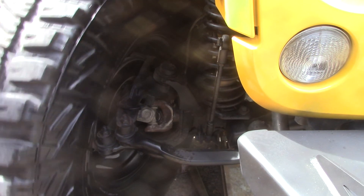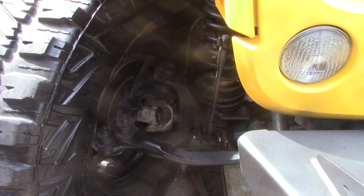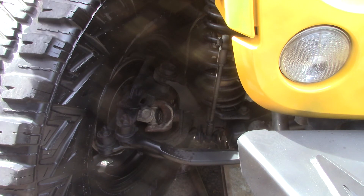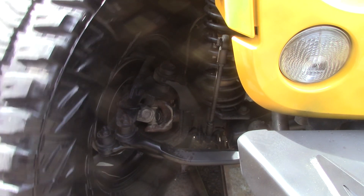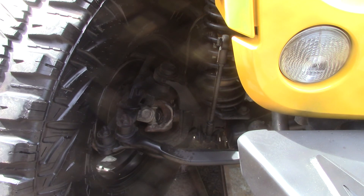Locking hubs really put you back in control. With locking hubs, you can enjoy your four-wheel drive, but as soon as you unlock those hubs, you can enjoy your two-wheel drive also — true two-wheel drive, not dragging anything — just like that Acura you drive to work or just like that old Buick grandma's got. That's a two-wheel drive: the front wheels spin on the hub bearings, and that's it. They ain't turning no shafts. God bless you, God bless America, get on board, get you some hubs.